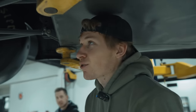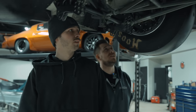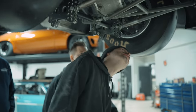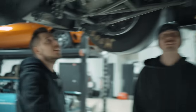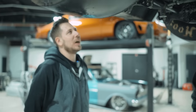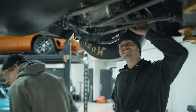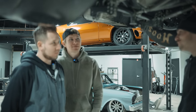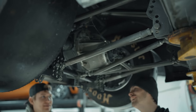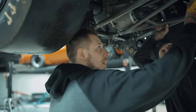Look how tiny that anti-roll bar is. We'll split the difference and put like a ski on it, honestly. We'll have to fix the wishbone in this just like we fixed the wishbone in the other one. The housing might be a little better than the one in the Nova. The shock bracket they got going on? Those are trash. Using that wishbone as a travel limiter - that's crazy, it's right up against that deal.